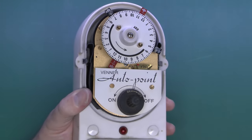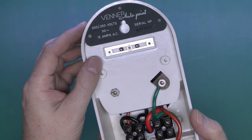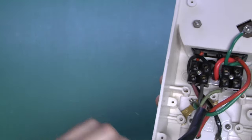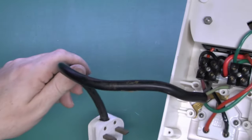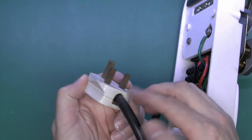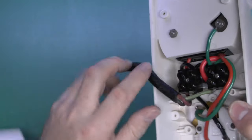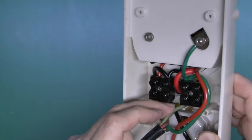A fairly standard Venner timer is fitted in the top, and this was presumably fitted on a wall or something, although it's not clear how this flex would have actually worked there because there's no cutout in the casing at all - it's just sort of placed there. Due to the age of course there are unsleeved pins on the plug here, which of course you're not supposed to use anymore but plenty of people do. This is actually some kind of rubber flex here with the old colours - the red, black and green.